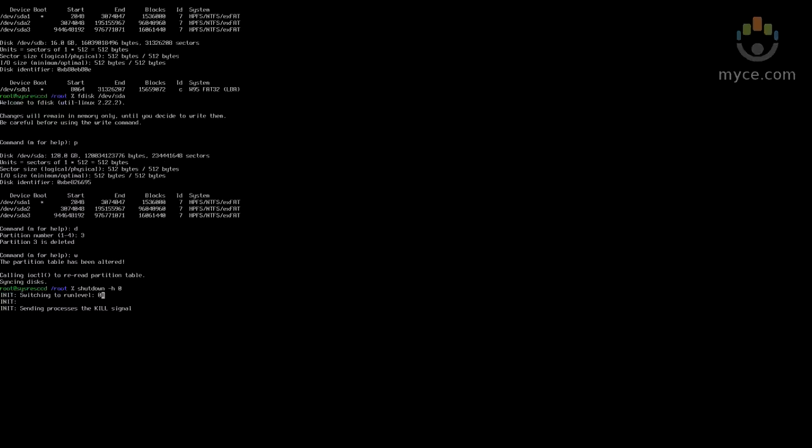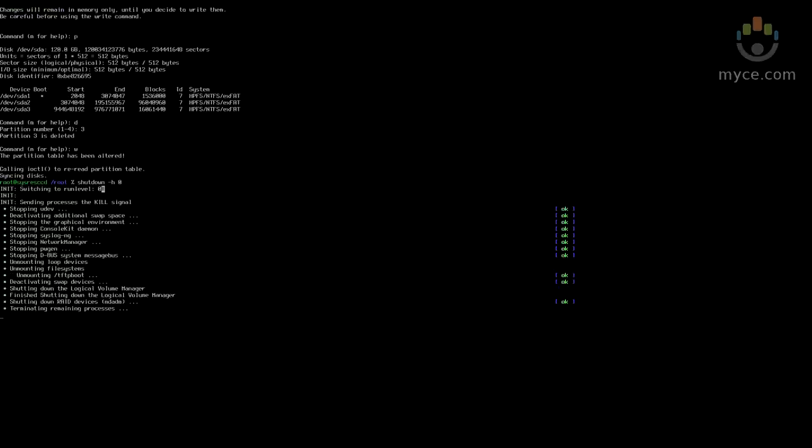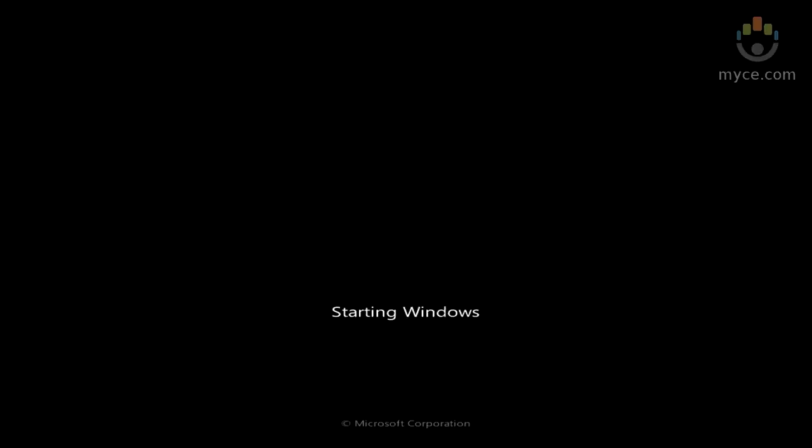When a partition is resized in gparted, it triggers a check disk operation, so this happens the first time the solid-state drive is booted. As the solid-state drive is a lot quicker than the hard disk, this process goes pretty quick. The first full boot usually takes longer, as Windows has yet to configure itself for the solid-state drive.